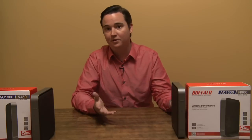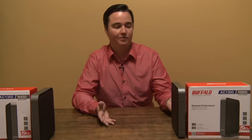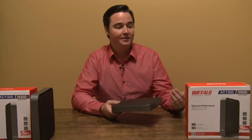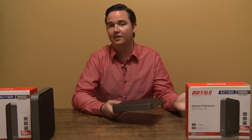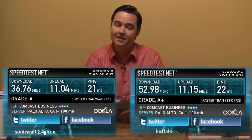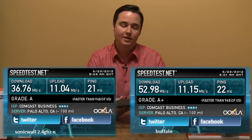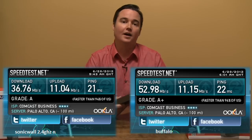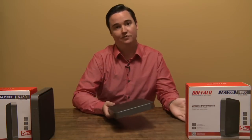Now one of the things you're most concerned about with this type of router is, is it really fast enough for my internet connection? This is the fastest standard 802.11ac, and in my tests it's much faster than wireless G, B, and N, but it's not really that much faster than a good dual-band wireless N router. I have a 50-megabit internet connection, and this was able to handle it over wireless just fine.